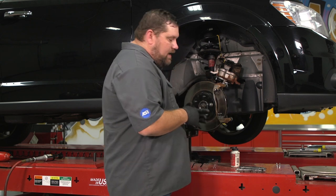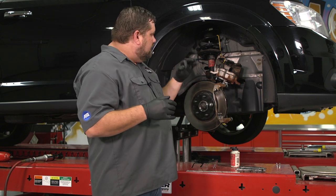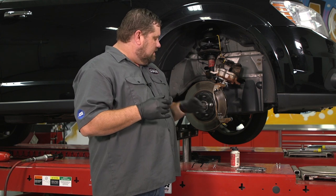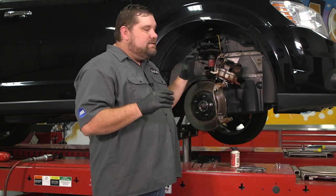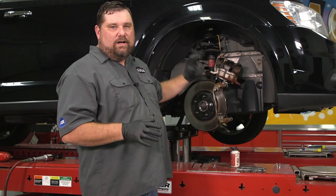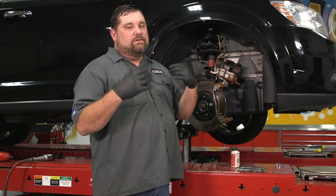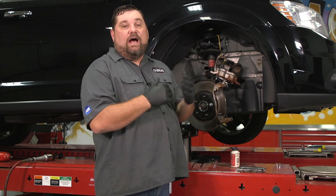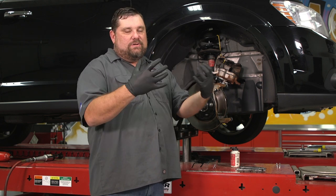Now I've got that thing nice and lubed up. The back of my pads aren't slathered with brake grease, so they're not going to collect a bunch of dirt, grime, and road debris that can cause problems later on. I haven't used a whole bunch of grease, which saves on shop supplies, but it's a nice clean install that does exactly what it needs to do — the lube is where it needs to be. I've lubed the T-heads, I've lubed the contact points on the caliper, so at this point I'm good to put the caliper back, torque those bolts to spec, and this car will be good to go. Whether you're replacing brake pads or just had them off for some other reason, you can follow this process and help avoid brake comebacks from noise or calipers dragging.